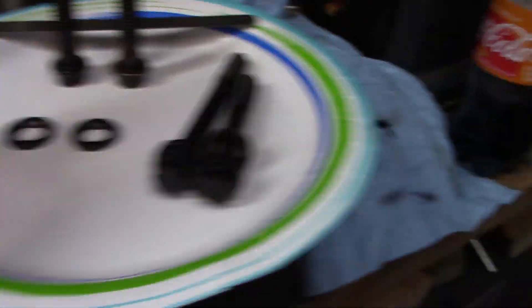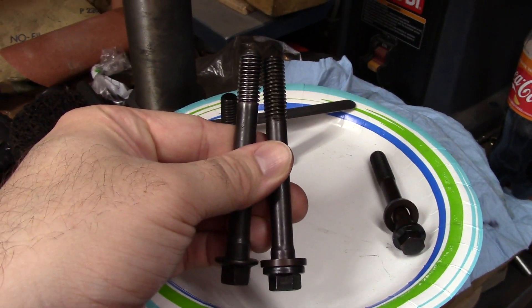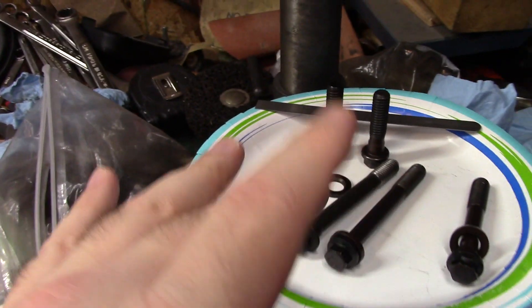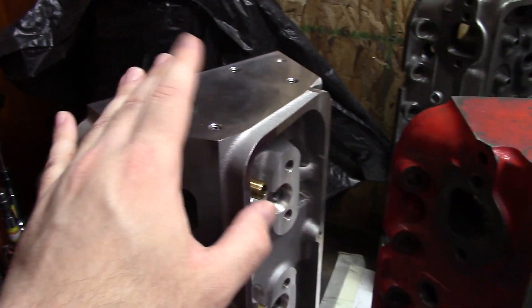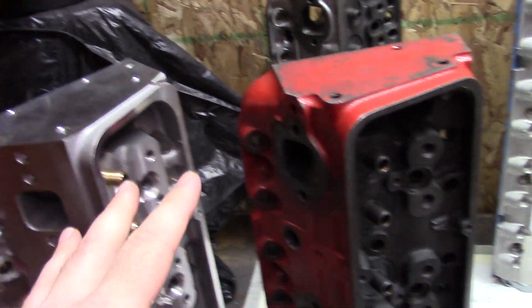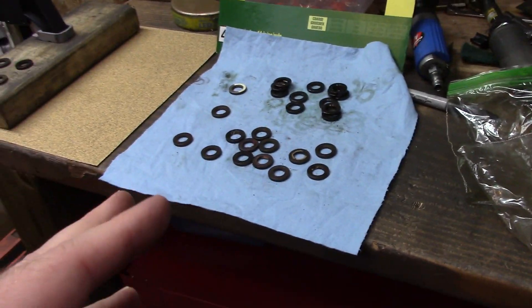I was comparing the actual lengths of the various bolts. With the washer on, the JEGS bolt is pretty much the same length as OEM. ARP has multiple bolt lengths for various head thicknesses and blocks. I checked my JEGS bolts on the eBay heads and they stick out slightly more, but on an OEM block with through-bolts I don't have a length issue — there are plenty of threads engaged.